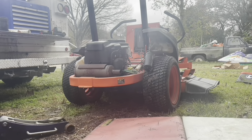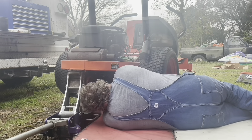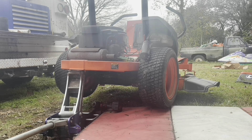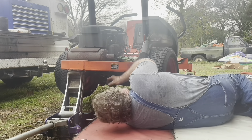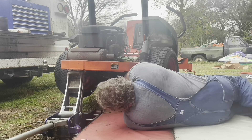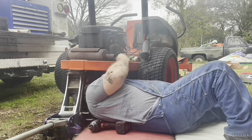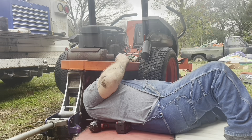We're going to lay out our mat because we've got to get underneath the mower. My air compressor pump has quit working so I don't have air to lift this machine, so I'm using a jack and I'm not able to get under it as far as I'd like to. The electric PTO has got to come loose — you've got to drop it and drop the drive pulley off of it, and then you have four bolts that hold the engine on. I believe all that was 14 millimeter.